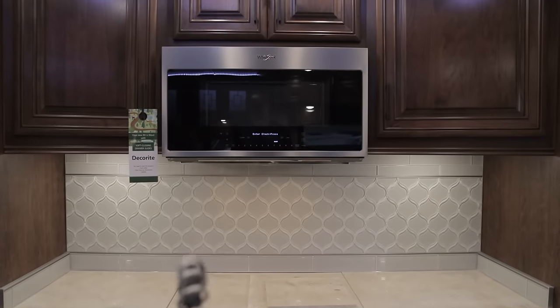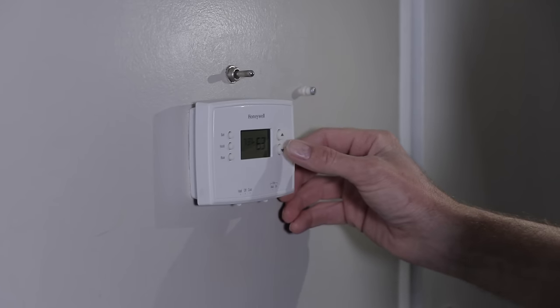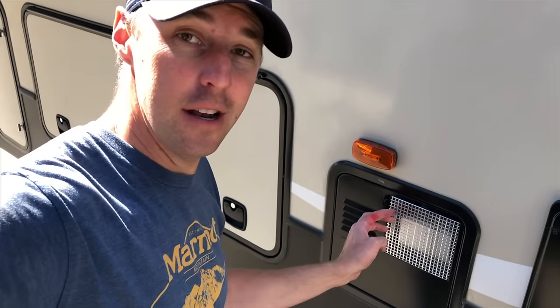Let's start off by looking at the AC side. That's going to be devices like a microwave, your typical outlet, the AC in the RV, a typical TV, electric fireplace inside of the RV, a water heater on electric setting, fridge on the electric setting, and our first line-blurring device between AC and DC — the converter. That's all powered by the AC side of the RV when we plug into shore power.